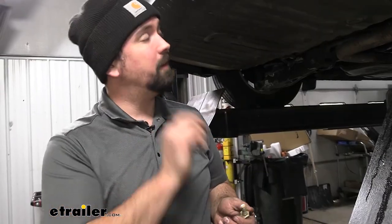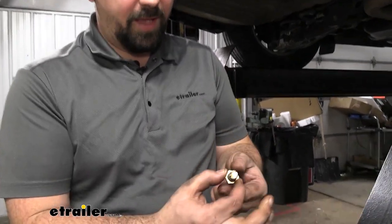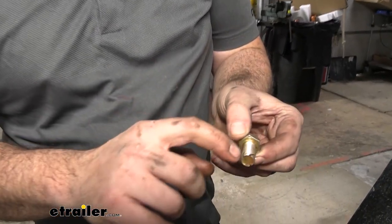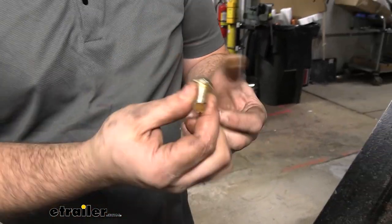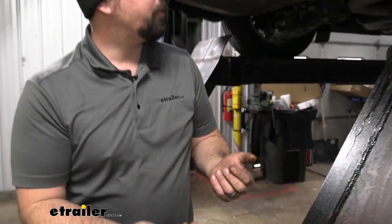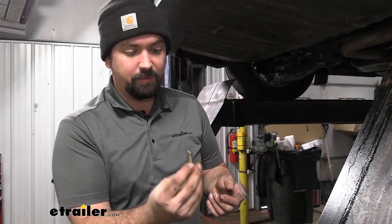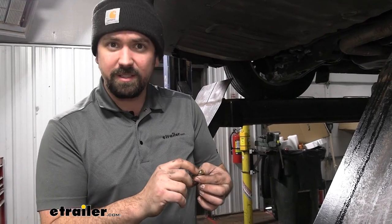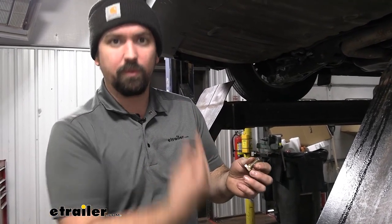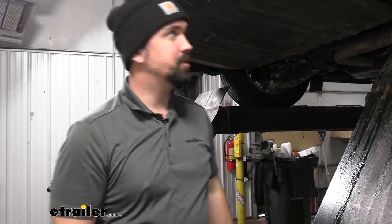These bolts gave me a little trouble clearing out the rust to get them started. I found a bolt with the same thread pitch, cut some slots in it with a cutting tool, and that turns it into a makeshift tap. Just make sure it's the same pitch and thread. You can also get a proper tap of the same size to clear things out. The main thing is to be able to get at least a few threads started before putting the hitch up — run it in and out a few times to work through the rust.